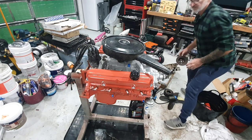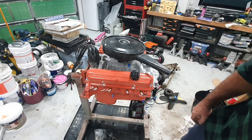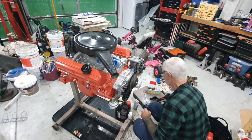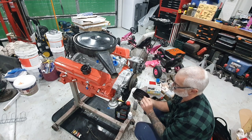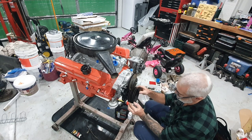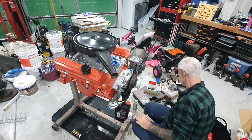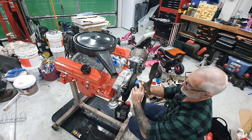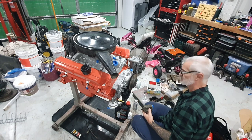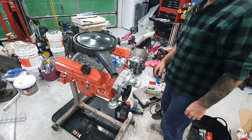We're definitely getting close. I've got to get the air cleaner blasted and powder coated, get these pulleys blasted and powder coated. This is actually the wrong pulley for the bottom — it must be a Statesman Caprice or something, it's a three-groove pulley. It will work if I use the centre groove but it's not the right one — I need the smaller one that lines up correctly. I've got the bolts and the fan that goes on the front. Once the correct pulley turns up I'll send everything out to get blasted and coated, put them on the engine, and it will look a million bucks.